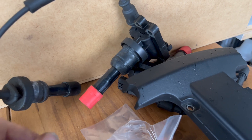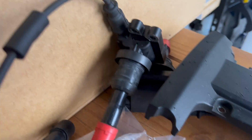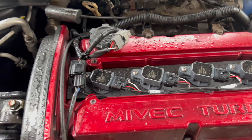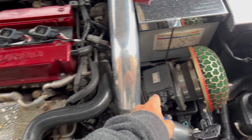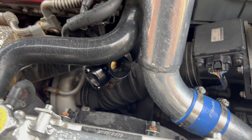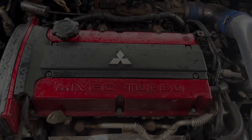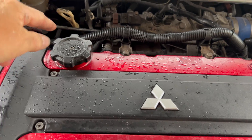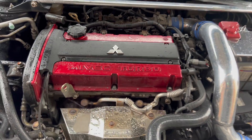Normally you'd have a coil pack with four leads coming off it, but this looks like two coil packs with two extra leads each. Tell me if I'm wrong, but that's what it looks like. Straightforward enough — quite happy with that, and most importantly it works and runs. I can't swap the intake pipe until it's at the mapper, since I need to drive it there with it still connected. So next up is mapping. Easy enough to sort — just trim a tiny bit of the wiring loom and push it back down. You wouldn't even know it's there. Coil-on-plug done!